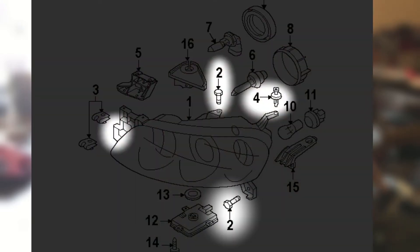Now you will want to remove both headlights by removing the two bolts pictured at the top middle, the bottom right, a clip at the top right, and also a bolt holding the light onto the bottom left. Next, we will be removing the bumper support, labeled in this diagram as number seven. Before removal, do a walk around and make sure everything connected to it is disconnected. Once you are sure it is free of attachments, remove the eight bolts holding it to the frame rails, highlighted in the picture.